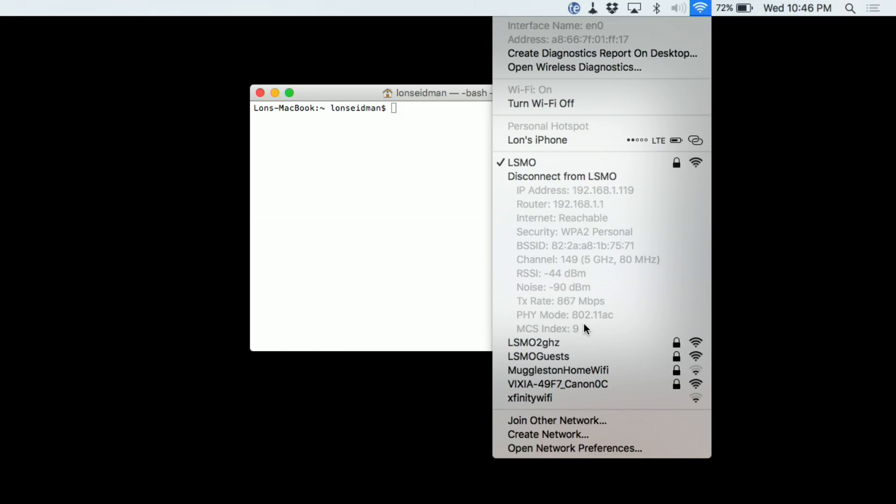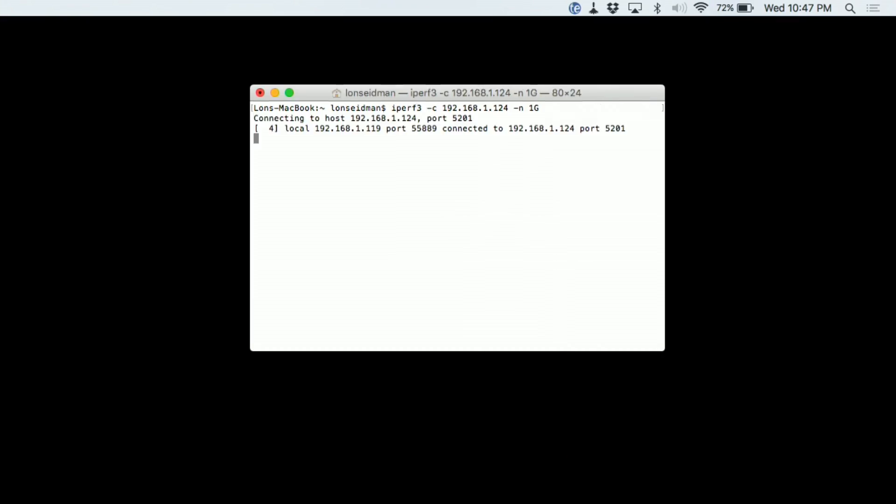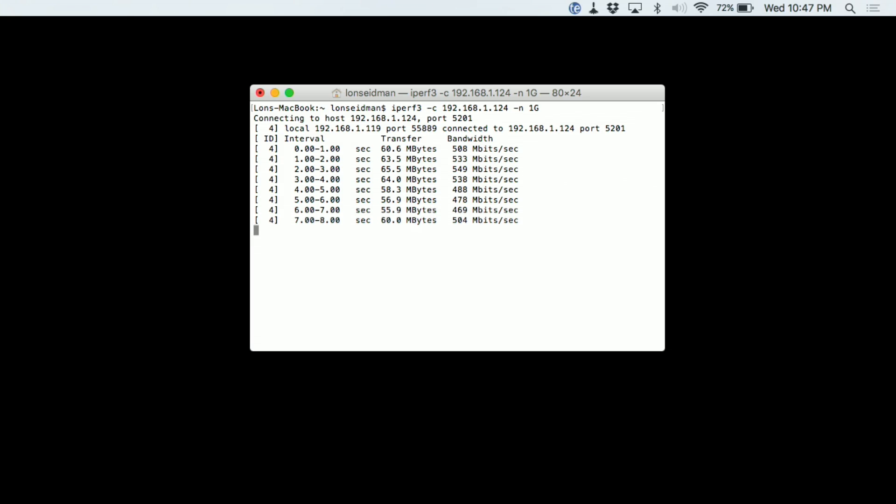The performance on these is pretty good. Right now connected to the access point behind me, I'm getting a connection speed of 867 megabits per second. These are two-by-two wireless radios — dual-channel wireless. Running a quick speed test with iPerf, we're getting about 500 megabits per second as the only client on here — pretty good speed. This is comparable to what I've seen on other AC wireless devices, including ones with a ton of antennas. These are a little more attractive for home or office and don't look as obnoxious, but they perform in a similar fashion.